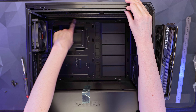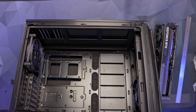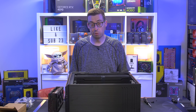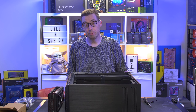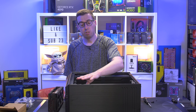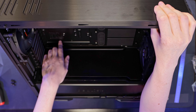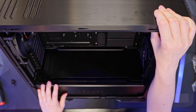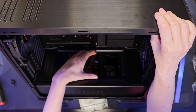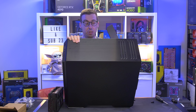Once the top tray is slid in there's still loads of room for cables running up through the top. The grooves at the top are the only hot-air exhaust points, so bear that in mind — don't over-overclock if thermals are tight. Along the bottom there's space to route USB 2.0 headers and front panel cables. The PSU shroud is mostly solid but has a couple of removable panels, including one to accommodate a thick front radiator.